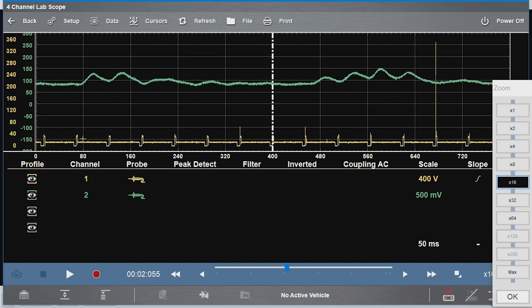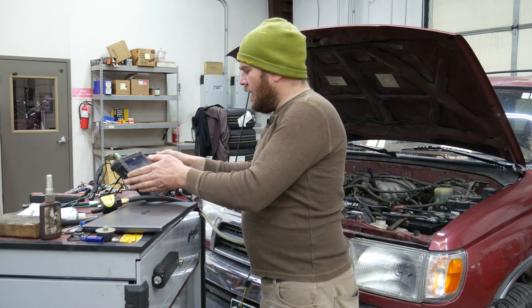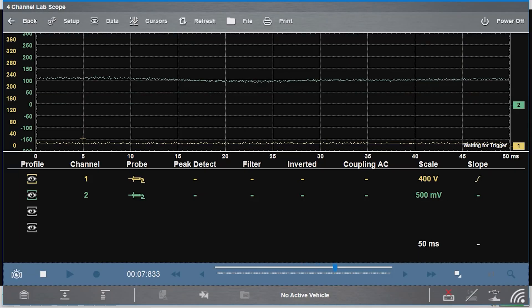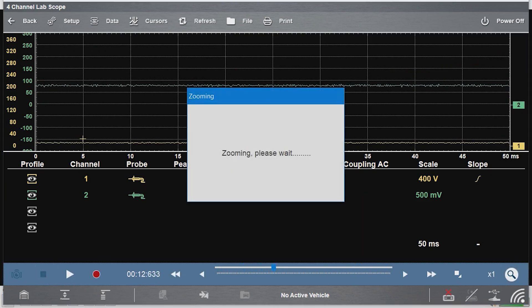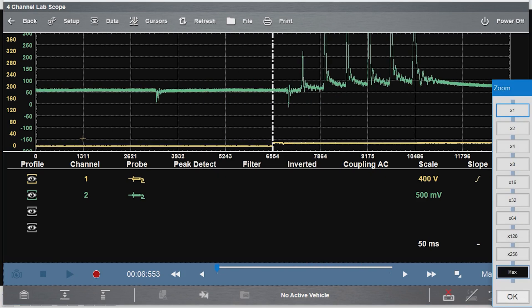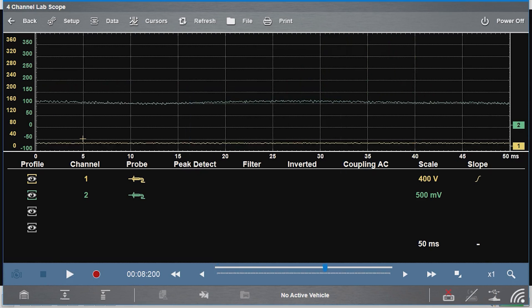Now, I don't have clear flood mode on this vehicle. I'm going to disable ignition — we're going to lose our sync. If we see a better pattern in the cranking format, we're going to have to find another way to get a sync channel. Ignition is disabled. Let's see if we get a better signal this time. There we go — now we see something here. We are seeing distinctive pulses, very large pulses in the cooling system. Let me zoom in on one of these cycles here.